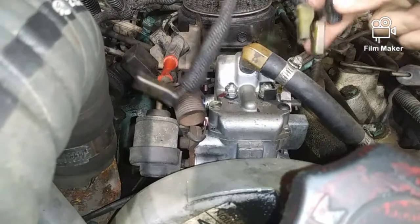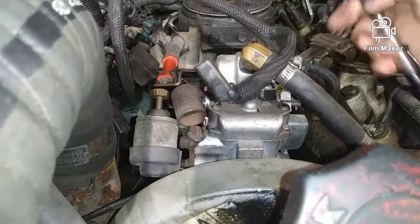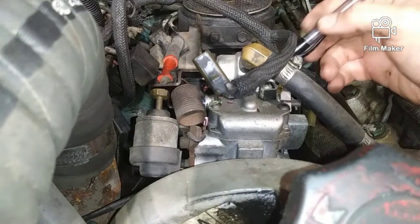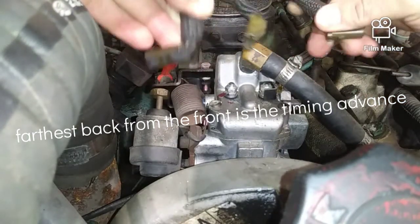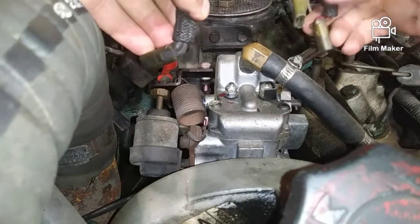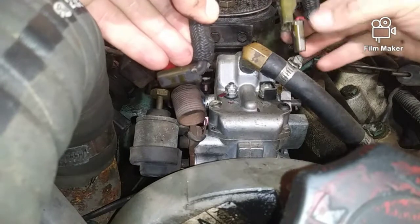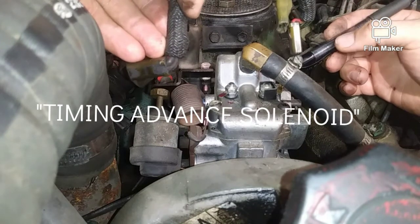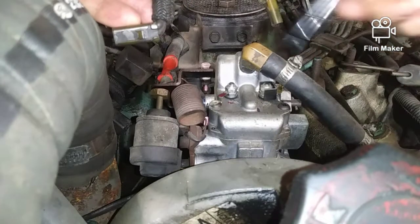This other wire back here is your advance solenoid. There's a terminal that's furthest back from the other two. This one advances the timing and waits for the same signal that the high RPM solenoid does — so these two actuate at the same time, which changes the whole characteristics of your engine running. Additionally, the advance timing solenoid helps with bubbles, sends fuel back to the tank, and helps purge the IP pump.